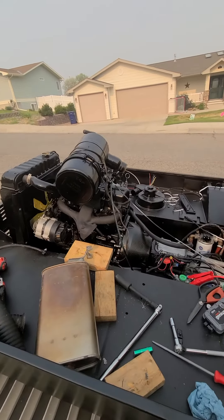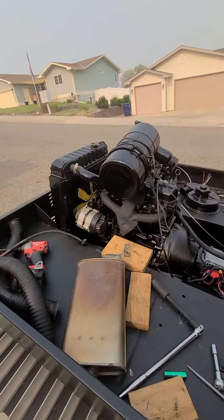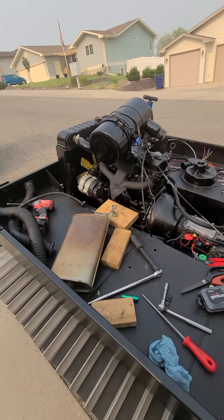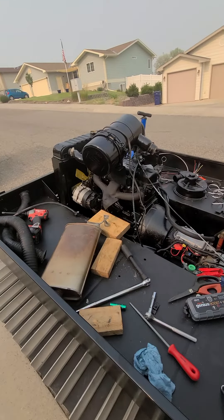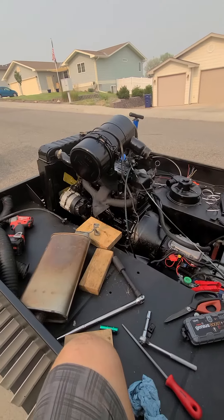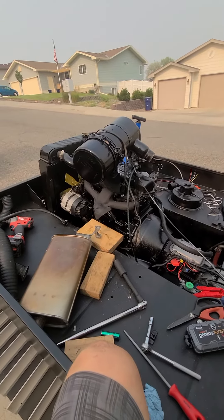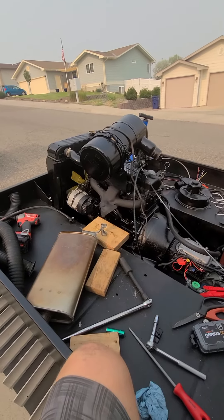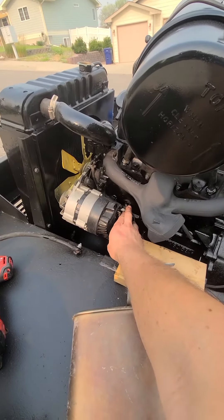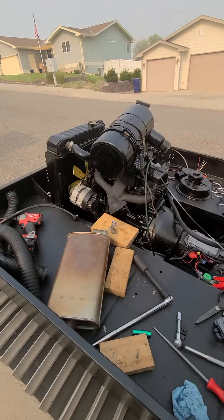I'm happy — I was right about the alternator. Not sure if it was a pressure wash or something, but it was shorting. Every time I'd start it, it would just click and then the system would die. I basically took a wire off from the alternator, the one closer to the engine, and it started to crank.